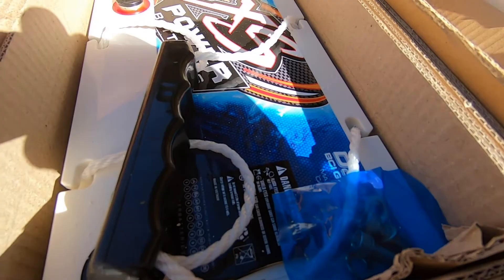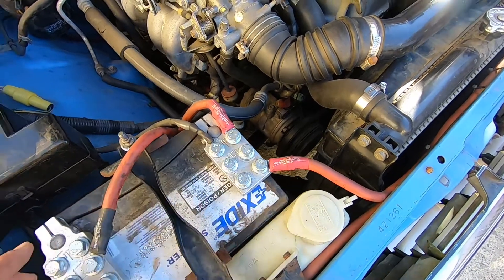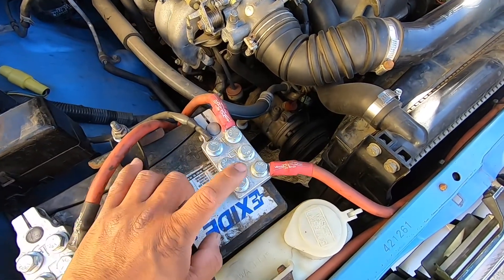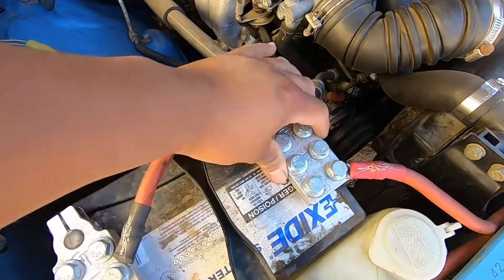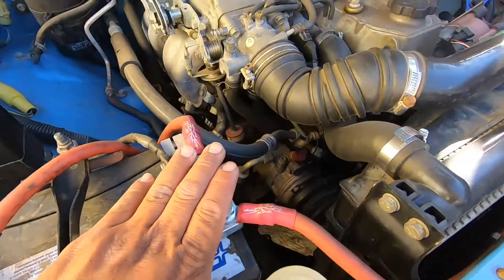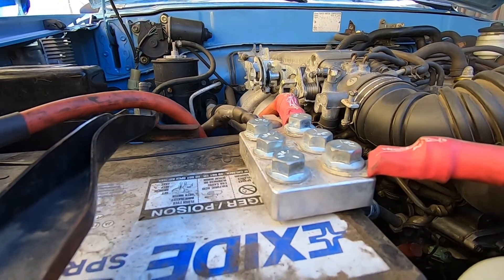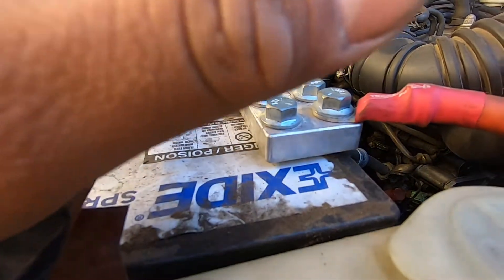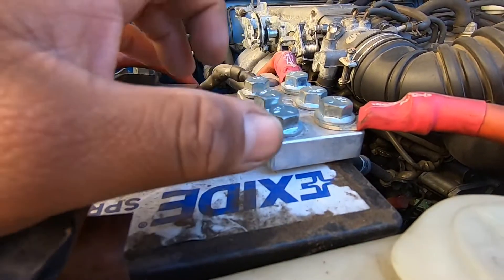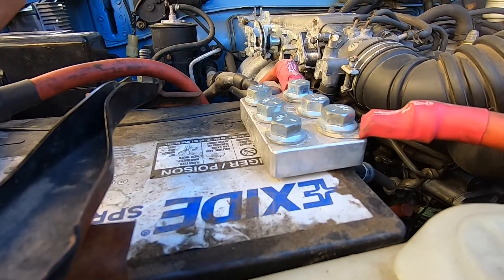Let me throw it on the truck real quick. Let's walk over to the truck and show you what we're dealing with. So this is the battery in the truck right now. We already did the big four upgrade, so we use these big six-post GP battery terminals — they're pretty beefy. The only thing is that these sit too high, so the D2400 that we ordered for this truck is an inch higher than this battery, so I'm pretty sure that would make these battery terminal things hit the hood.